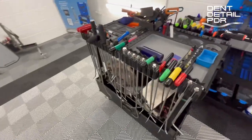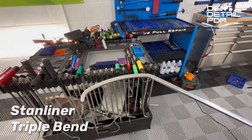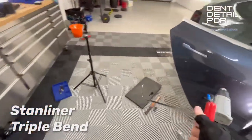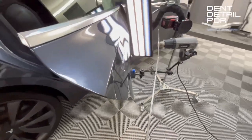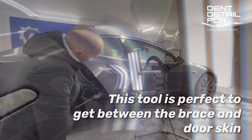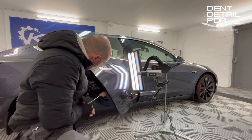Tool wise, what I'm going to use here is a stand liner triple bend — as you can see it's hooked. Where this dent is, above the brace, once we're coming up from underneath, the hooked end of that tool will reach pretty much bang on where we've got to be. It's still awkward — you've got to come up outwards and then back round on the inside of the brace. It's a tricky one, but we can definitely get there.